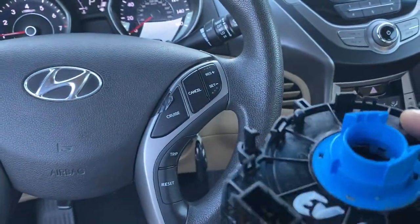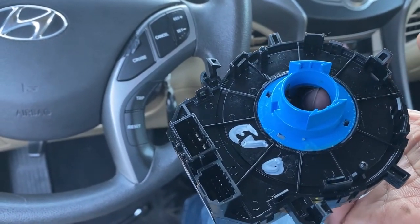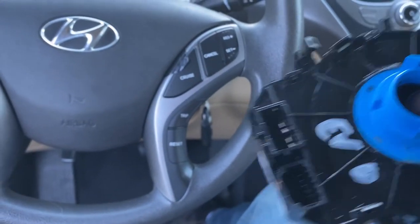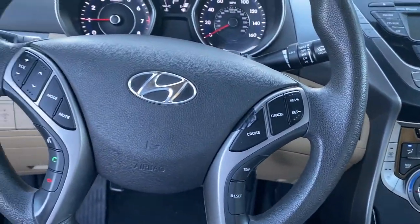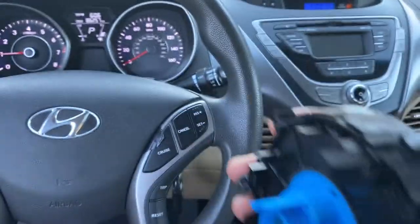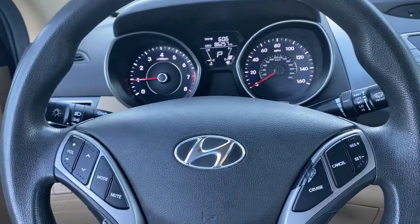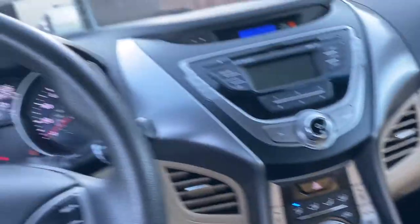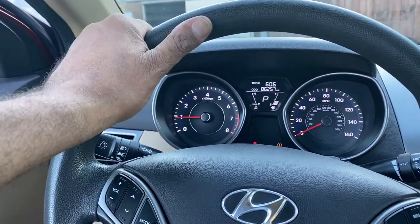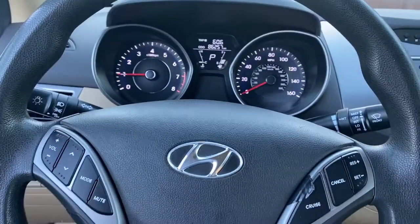Open the back cover and look at the ribbon cable - you're gonna see one of the connections is loose or broken. It's a small wire. Remember, when you drive all day turning right and left, this wire stretches back and forth until it breaks. Alright guys, see you in the next video. Hopefully we can do a complete airbag reset next time. If you like the video, please subscribe and like - see you in the next one, thank you.